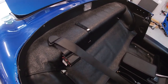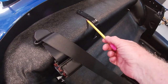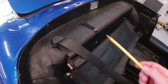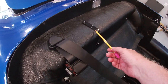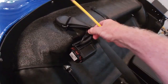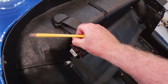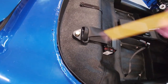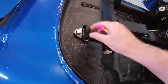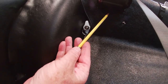All right, seat belt installation on the passenger side. On the original jack system there is a reinforcement bracket with two holes to locate it, and I'm making use of that bracket — you can just see it there. This is the D-loop, so what used to be the retractor location is now the D-loop bolt, with a plastic cover going over it. This is the retractor unit and the bolt is underneath here under a cover.